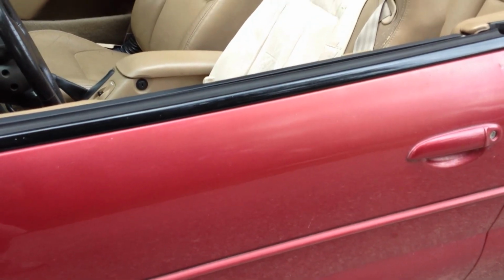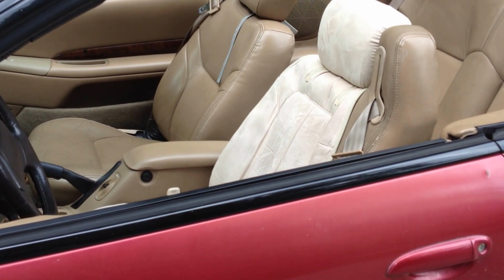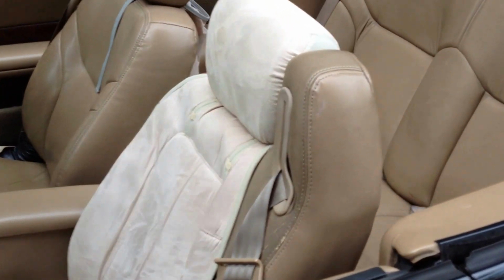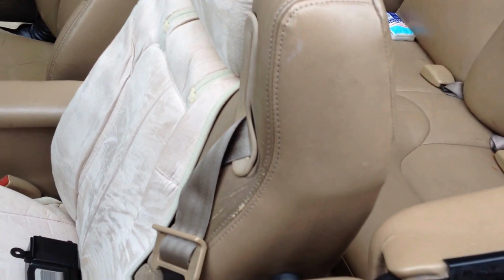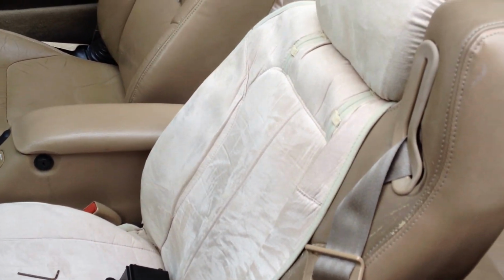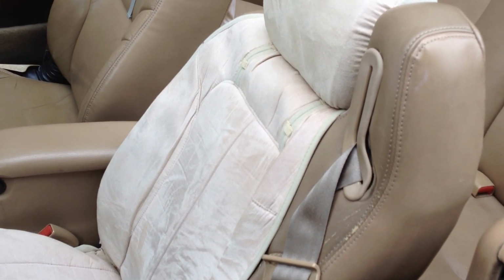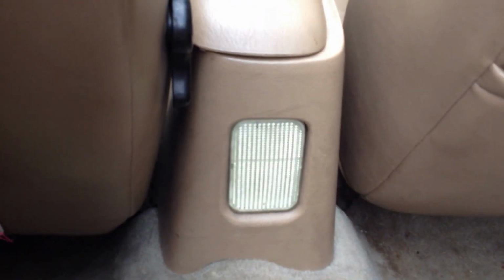This video is to show you how to make a seatbelt repair on a 1996 Chrysler Sebring JXI Convertible. The seatbelts in my car would not retract from their holder. That's because the inertia module for the seatbelt was broken. On the convertible, this repair is unique because there's only one control module for both seatbelts. That inertia module actually sits below the center console in the center of the car.